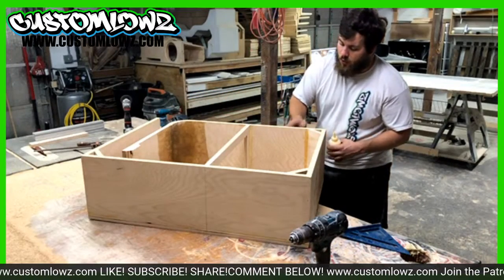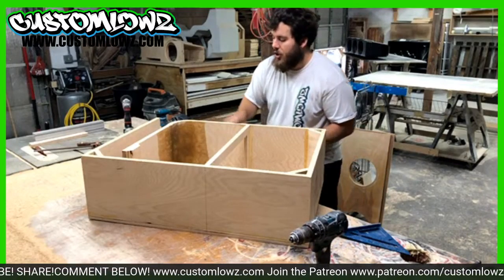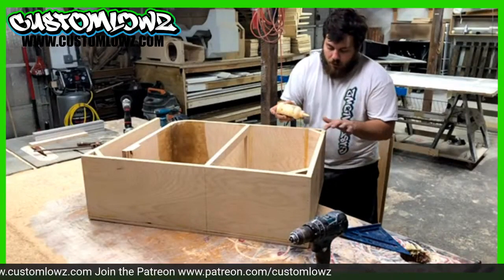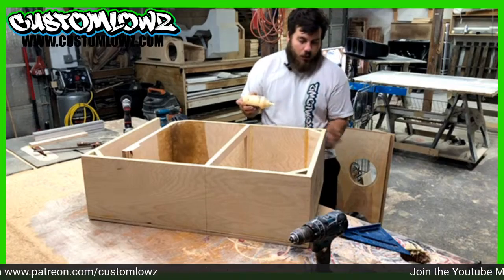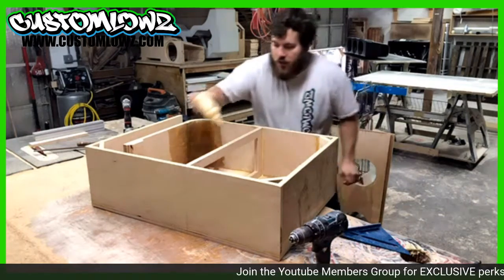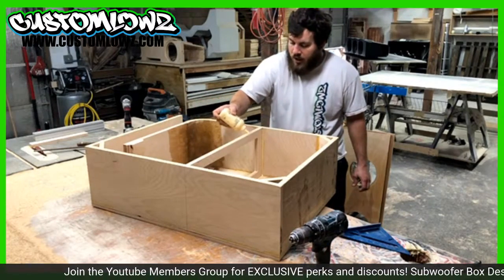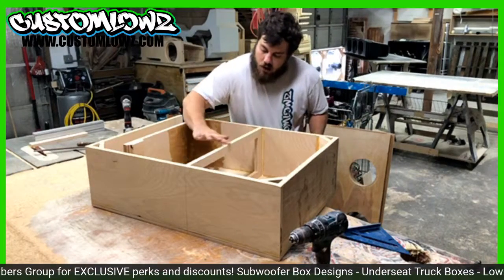We're working on a box for 4 Skar Audio ZVX-8s right now. This is part 2 of a multiple part series. In part 1, we got the kerf cut. We got the box mostly assembled right now. I'm working on getting the tops on. We already cut the sub holes out. We got our flush mount and our mounting layer. It's a double baffle we're putting on here. Right now I'm just spreading out the glue to get this thing ready to attach.